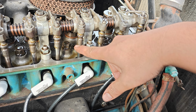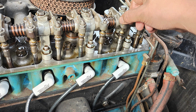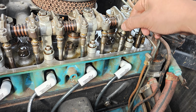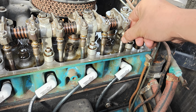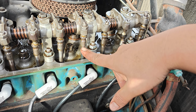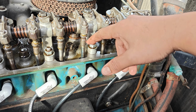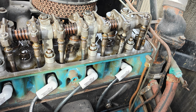Not really holding my breath on that, but there is at least a little bit of a lobe left on the cam. But yeah, that's probably gonna be my next thing to figure out, whether the length of the push rod is correct. Maybe I get lucky. I'm trying to avoid taking apart the engine, but I know deep down I should. So yeah, joys of a project car.